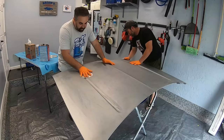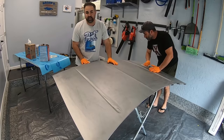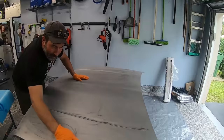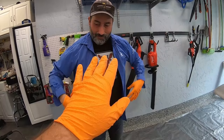The chemical strippers are not what they used to be. They removed some of the hazardous chemicals that can cause cancers, and now they don't do as well of a job, but they're a lot safer. After it's all scuffed, it should look something just like this. My recommendation is to do this in an area that is a little bit shaded but also ventilated, because if there's direct sun, it's going to dry up our paint stripper too quickly and not allow it to do the job it needs to. These are still hazardous chemicals, so make sure that you do wear long sleeves and gloves and have a good respirator, because you don't want to get this on any of your skin — it really burns and it's not good for you.